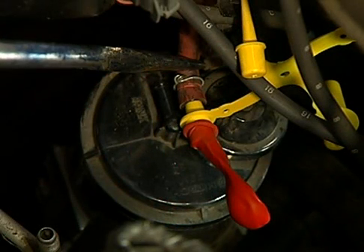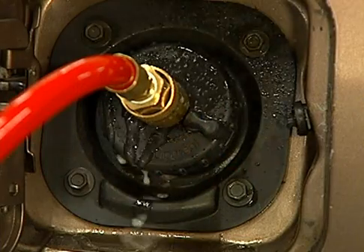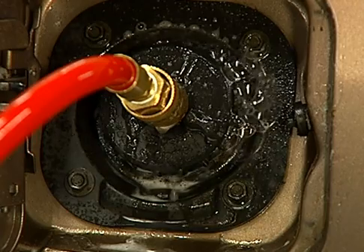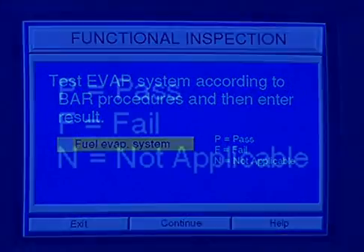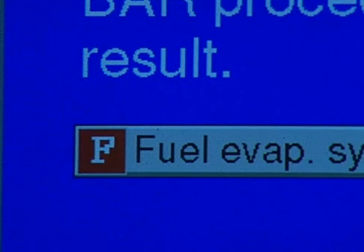To do a seal verification test, the vapor hose must be disconnected with the pliers still attached, and you must insert the special balloon plug. If the balloon fails, then the crimp pliers are not sealing correctly. In cases where the hose can't be removed, you would attach a second pair of crimp pliers. Also, check for leaks around the filler neck adapter. In either case, we need to follow the prompts to ensure a proper seal before entering fail into the EIS on the second and final entry.